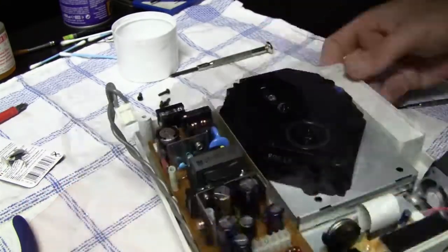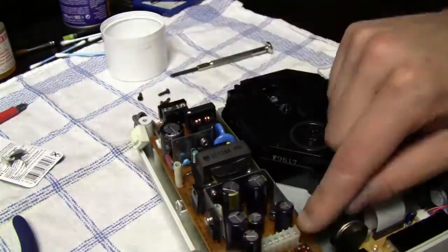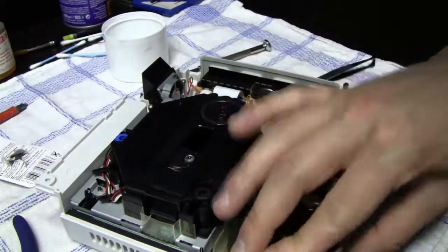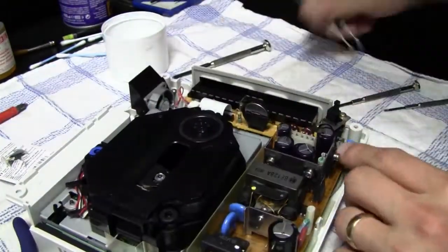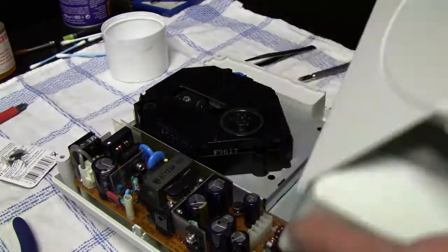And in the end, you have two options. If you want to replace the internal battery, you can make the same decision that I did and buy one of those battery holders and solder it onto this little board, and then you can use those rechargeable batteries. Or you can also buy replacement batteries like the one that was already installed in those systems, and you only have to desolder the old battery and resolder the new battery into the system.